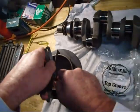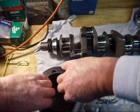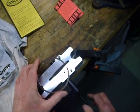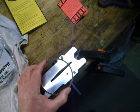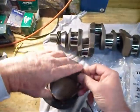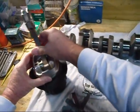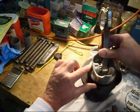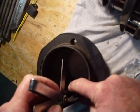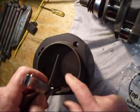The 25 does not fit yet. For about every 10 rotations on the grinder it takes off just about enough. So I'll go just a little bit more — say two more rotations — put it back in the cylinder, square it up with the piston, and now I am right at 25 thousandths.